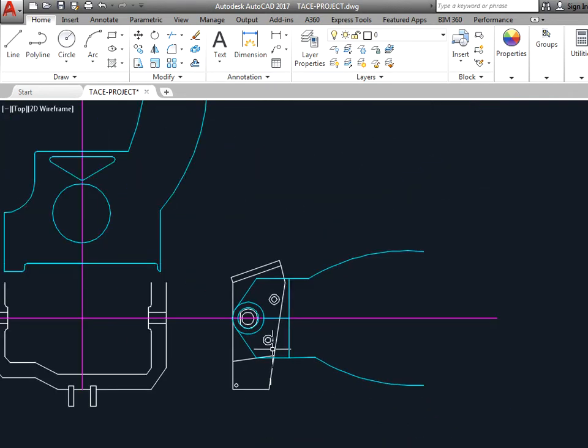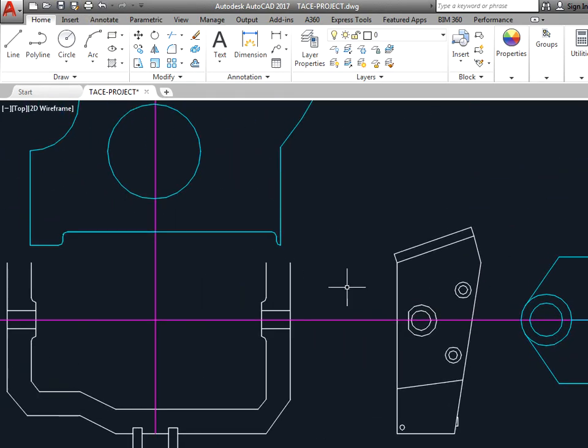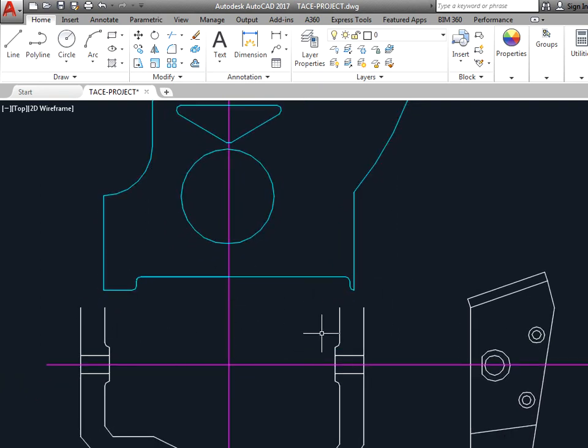Obviously, the swinging arm pivot bolt on the 955 is a lot bigger than the Thunderace one, so I would have to make a sleeve so that I'd be using the Thunderace bolt. So I think it'll fit that way. It looks as though it would do, doesn't it? It looks as though it'd fit that way from a side-on view. But whether it'd fit this way is another matter as well.